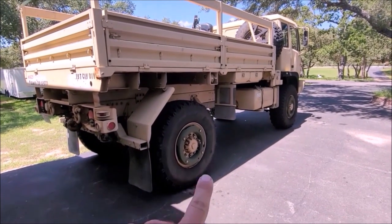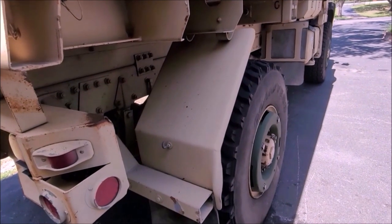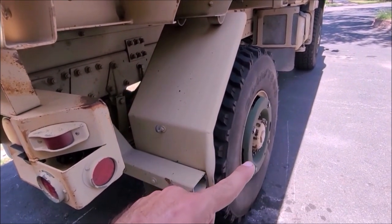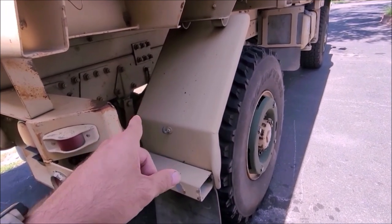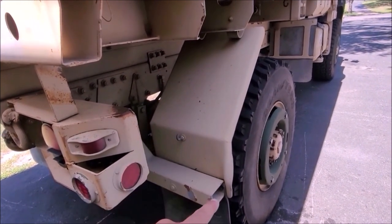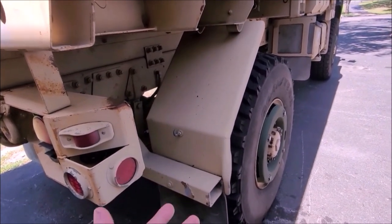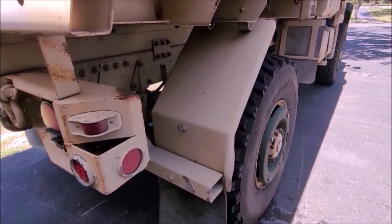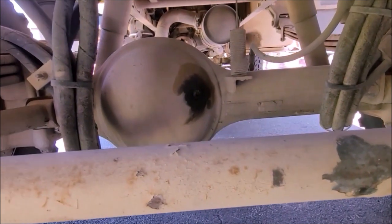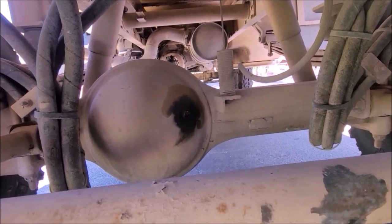This part is going to follow up with the hub service — I did both sides. Since you service both side hubs, all that oil was coming out when I was servicing the driver's side because your hubs share the oil with the differential. So if you're going to service your hubs, you're going to have to fill your differential. Whether you're going to completely drain and replace everything or just top it back off, it's up to you. Should be relatively simple. The only thing that's a pain is going to be the fill — trying to put all the oil into the axle through that hole, unless you're using a pump, it's going to be a pain. So what I'm going to do is probably route a hose.